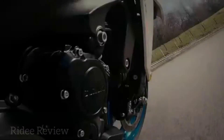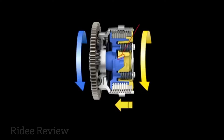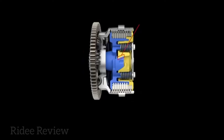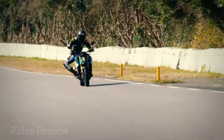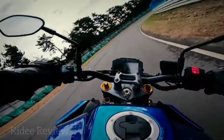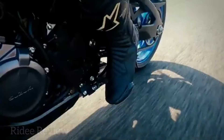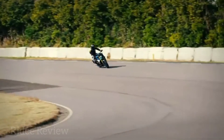Added controllability and increased performance also comes thanks to Suzuki's clutch assist system. The slipper clutch partially disengages to reduce negative engine torque and mitigate the effect of engine braking when downshifting from high RPM. This helps prevent the rear tyre from locking up or hopping and provides smoother deceleration, enabling the rider to shift down with greater confidence and maintain better control when downshifting into corners.